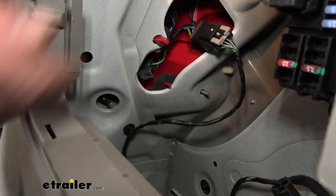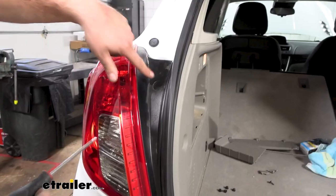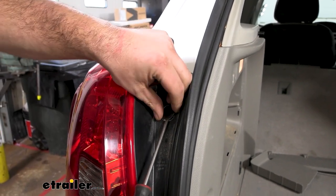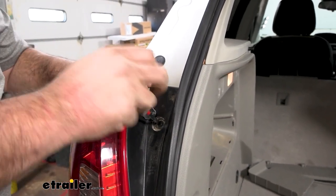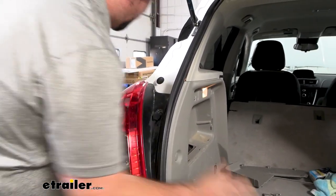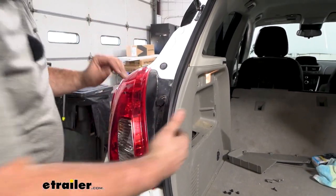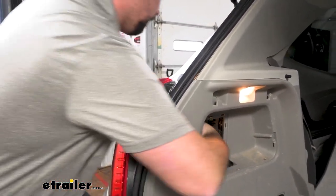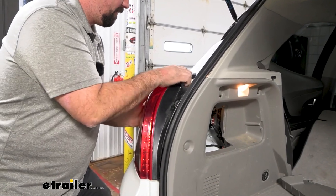That last one — you can kind of see the stud hanging out, so you will need a deep well eight millimeter socket to get to that. There's also a plastic cover here — pry this up, it's got notches on either side. That's going to give us access to our Phillips screw there, so we'll go ahead and get that taken out. Now getting your taillight to separate — sometimes it's going to have buildup over time. There is a watertight seal holding it in, so push on the studs where we removed those eight millimeter bolts to help push it along.